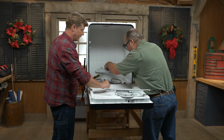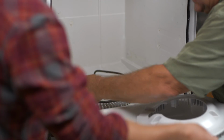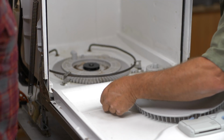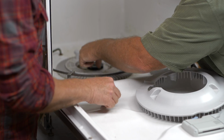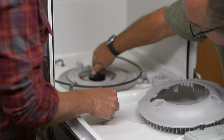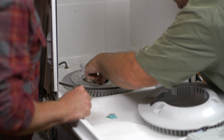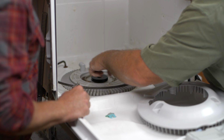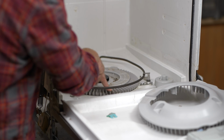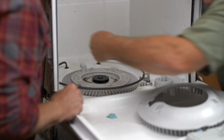So let me get this stuff out of the way. So, plastics. Here's your English muffin container sealer. Oh, a couple of them. Couple of them, okay. So if enough of these got in here, here's the grinder, the impeller. So this wants to all be clean because it's all trying to drive down through these small holes. See them? So this is part of the draining mechanism in here. It's not just out here. So you would clean that, clean everything you can. Here's plastics, more plastics.